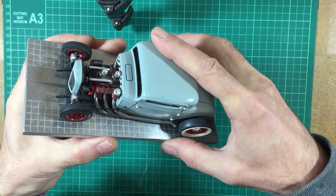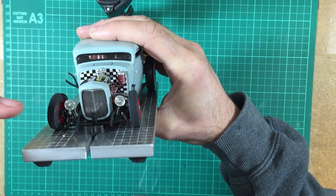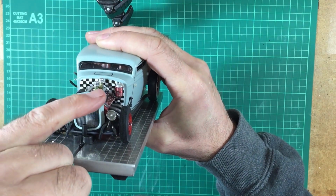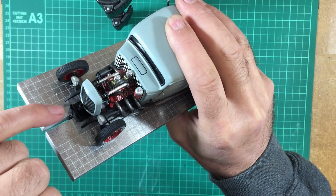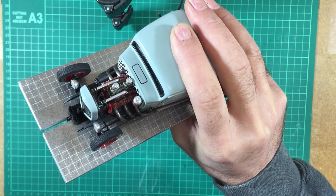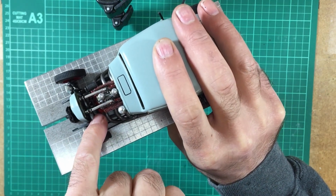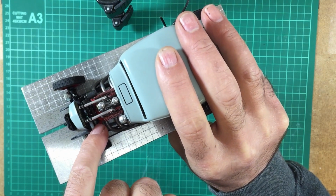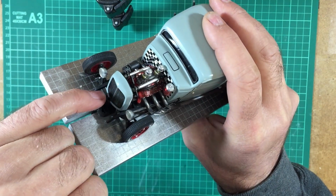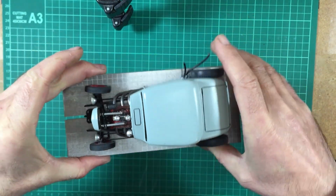One other thing I forgot to say was you need to allow for the front guide. So with the front guide in and that post just trimmed down, we can actually get the guide to snug up underneath this front radiator very nicely. There's just enough room. It will poke out just a hair, but that seems to be quite normal on these cars. There's nothing really I can do about it. And I don't want to put this guide behind the back axle because that will make some rather weird handling characteristics, and I don't want that. So it's not going to be too obtrusive, but it just means I have to design a tongue into that front beam to take the guide. So let's crack on with pulling this front end apart.